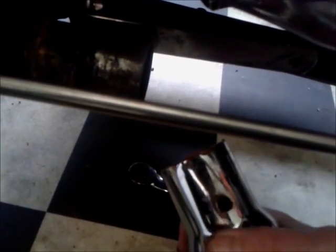The inner workings, that's just a bent bracket that holds that in place. The trouble is with the America downpipes, they're a slightly different diameter to the Bonneville one, so these went on that way, and that's the hole. The bolts hold the baffle in. Don't think I'm going to get them to go in that way. I don't know, I might. If I could just slice a little bit, push that in, maybe.